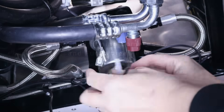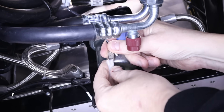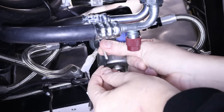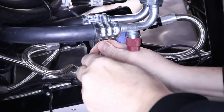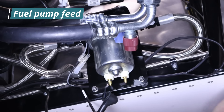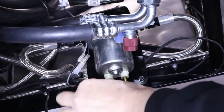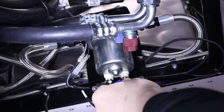Going back over the other side of the engine now. This is the feed to the air conditioning compressor — just two connectors, very simple to do, just connect them up and make sure it's routed nice and tidy and secured with zip ties. That's done. And you'll remember from one of my previous episodes I didn't know which one was a positive on the fuel pump — but clearly I can see underneath, so that's why I'm putting these on now. I've added boots to make sure road debris doesn't get on the connections.